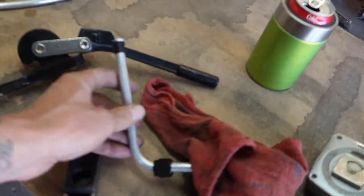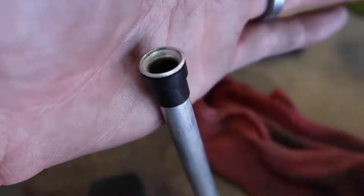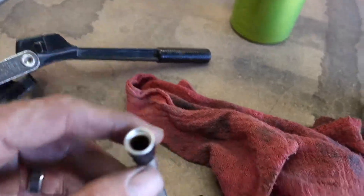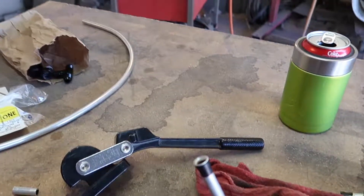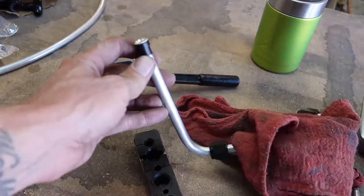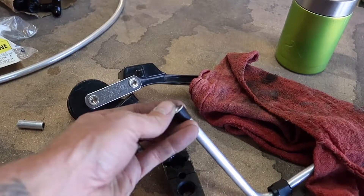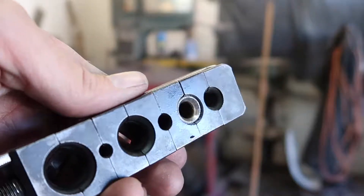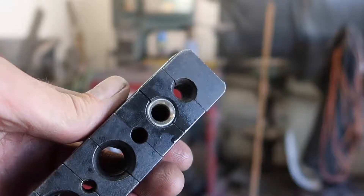I fired the car up and this guy here actually leaked. There's a little ridge in there — I thought I cleaned it and did my due diligence, but it left a little bit of a lip around the inside and it doesn't want to seal up. I could try to force it and tighten the hell out of it, but this stuff's all aluminum — you're not supposed to have to tighten it that hard. I'm just going to cut just the very end off, make sure I clean it up real nice, get a real good flare on it, and then try it again. Nice and smooth — that's the redo. No lip on that, so that'll seal up just fine. Let's try it again.